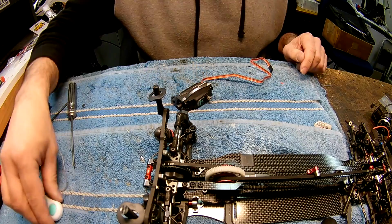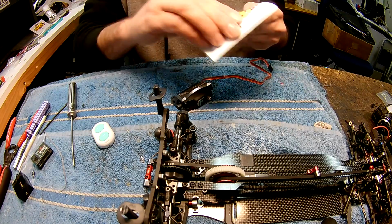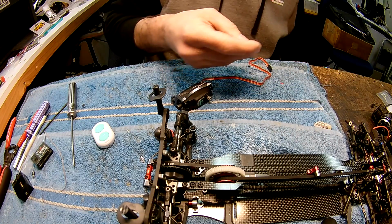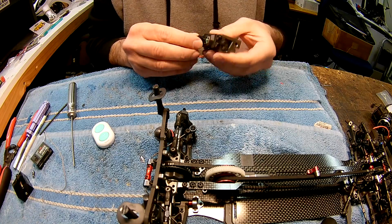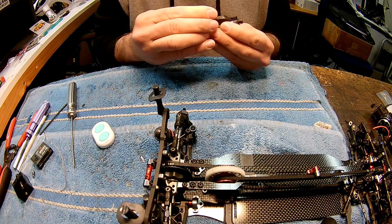That's done. We'll do the servo arm, which I think I have here in the box. Okay, servo arm, again alloy, so don't hit anything, you won't break your servo. Alloy servo arm, a lot stronger than the plastic ones that come in the kits, and a lot better feel. So all I do here is find centre for the servo as a starting point. Ooh, that's pretty good actually.